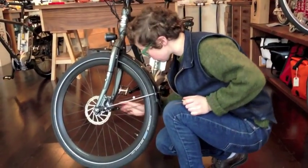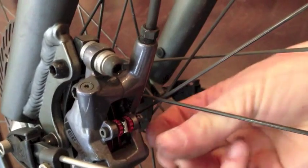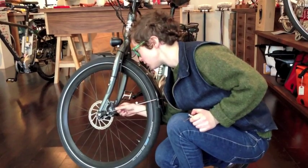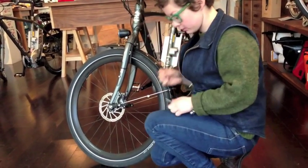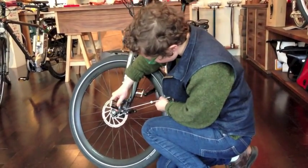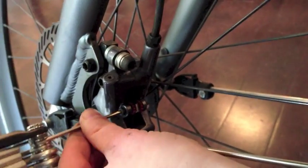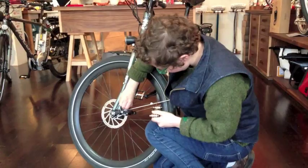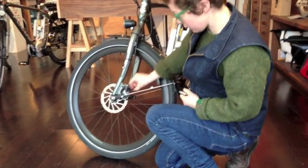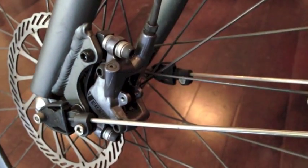You're going to go right here to this spot where you can see the end of the brake pads. There's a small safety pin that you remove just with your finger, and then you will take your wrench and loosen this bolt right here — righty-tighty, lefty-loosen. The bolt will come out and you simply pinch the brake pads to take them out.